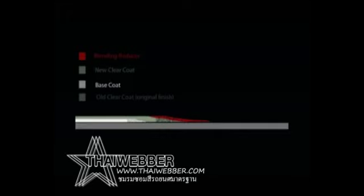Now here's just a quick look at how the edge breaks down when you're blending your clear. You can see the red zone, the clear tapers off. The blending reducer is used to make a smooth transition from your new clear coat onto the old clear coat. Now what can happen potentially there is that edge is weak as far as UV holdout goes, so the sunlight can break down that edge.